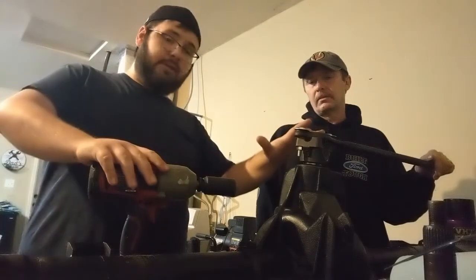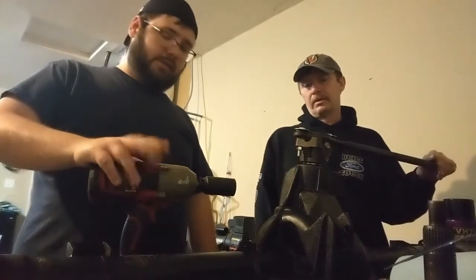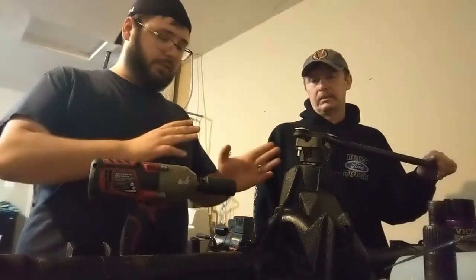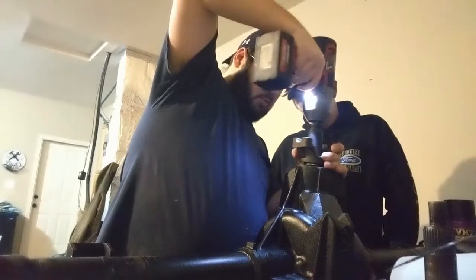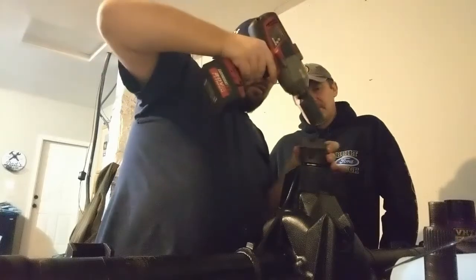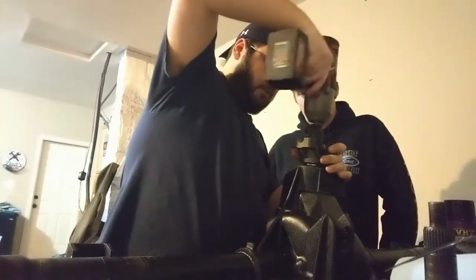So, the preload is 16 to 28 inch-pounds. We're at zero right now. No slack. So, it's going to come on quick. What I'm going to do is do quick little braps, and then I'm going to feel it. Now, hopefully I don't twist my damn hand off. I don't feel any drag yet. I see it move just a little bit, and then I check. I don't feel any preload yet.